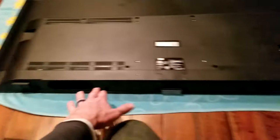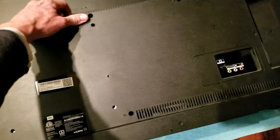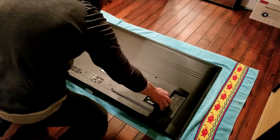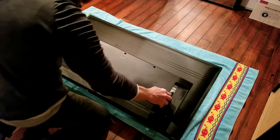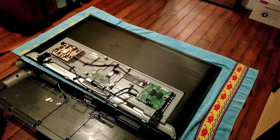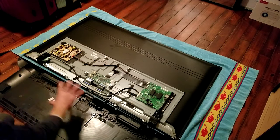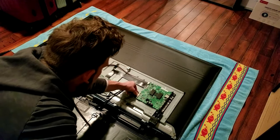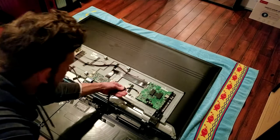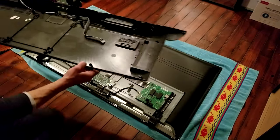The back panel comes off in two different pieces. Once the screws down here are taken off, this pulls back. Grab it with two hands — if you missed any screws, it won't come up very easily. Before you rip it off, be careful because underneath the back side you're going to have cables hooked up down here to your touch buttons. Go ahead and push down on this tab right here on your main board, then slip that back so the cable is loose and 100% free.